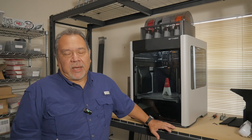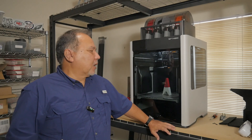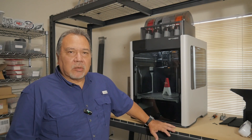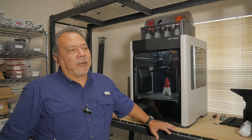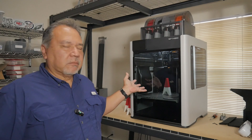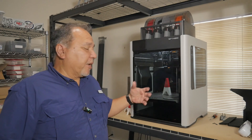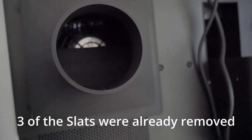I tried printing like that — I have the exhaust fan at 10% while it's printing and 50% afterwards, just like I do with the P1Ss. But apparently Bambu Studio overrides any kind of exhaust control whenever you have the heating element on. I even set the chamber heater down from 60 to 40 degrees C under the filament control, but it apparently overrides it because you can look in the rear here and the slats do not open.